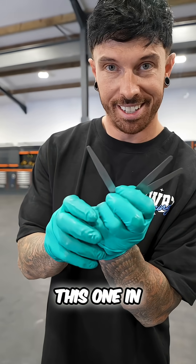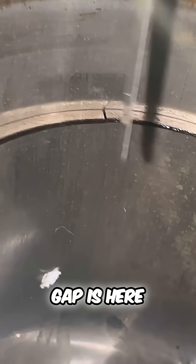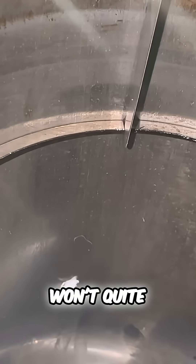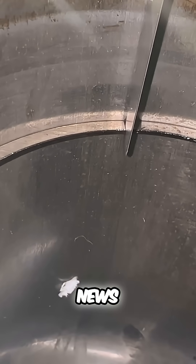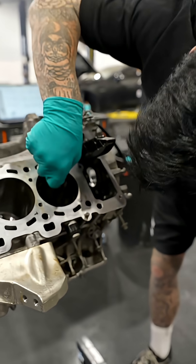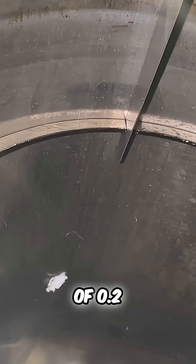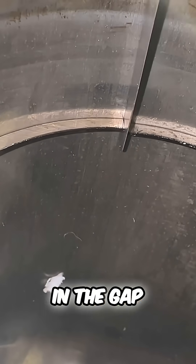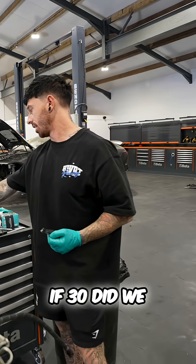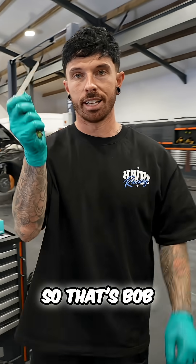You can see how small the gap is here, but this feeler gauge won't quite fit in the gap, which is good news because that's the wrong size. Yeah, look at that — that's good. The measurement of 0.25mm just fits in the gap. 0.30mm won't fit, but even if it did we would have been all right, because it says it goes up to 0.30 — so that's spot on.